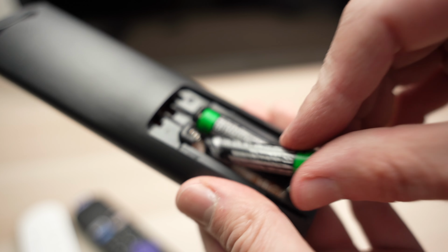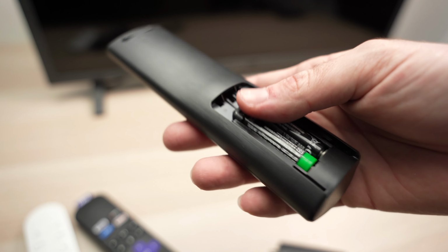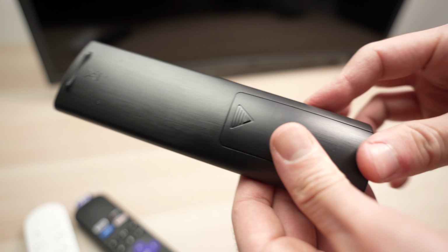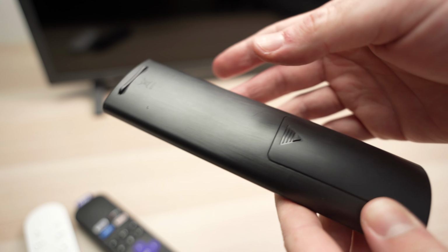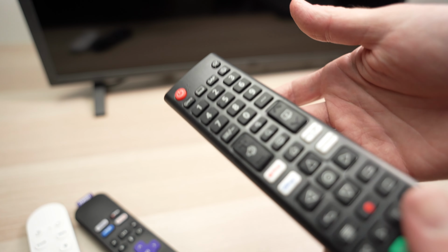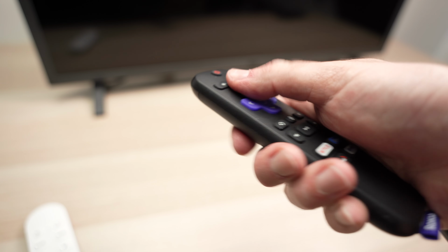Even if you still have a bit of juice left in your batteries, if they're not full or almost full, some remote controls won't work properly, unfortunately. Okay, now once you're done, go ahead, power on the TV, and if it's not working, try to do the same exact thing I just showed you with the other remote controls of the devices that are connected to your TV.